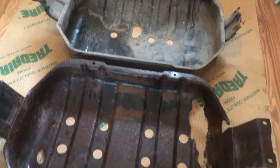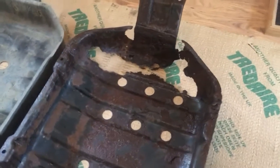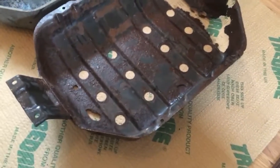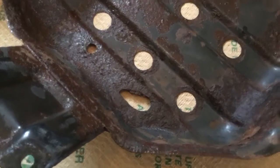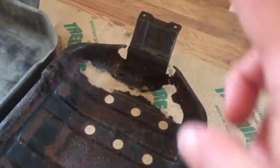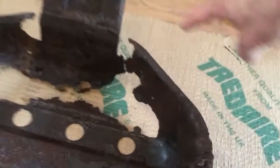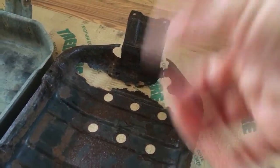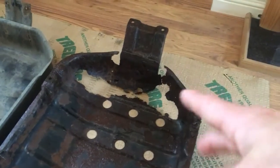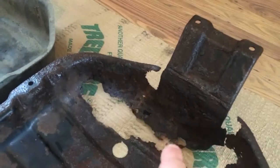They're pretty much bomb proof, whereas these Frontera ones just seem to be made from really crap steel that does that. And apparently mine is actually in pretty good condition compared to most, and when it started to go through at this side as well — you can see the hole there where it started to go through, and obviously that side's totally gone. Now, if it wasn't for that bit having snapped, it'd still be perfectly fine to do the job. But obviously because that side there has snapped, it's meant that the whole thing had started to drop because the only thing holding that side of the tank up was that thin bit of metal there.